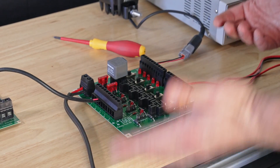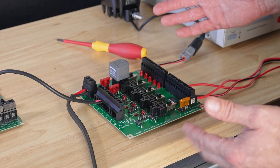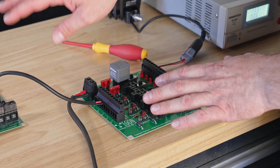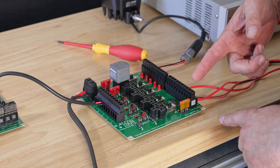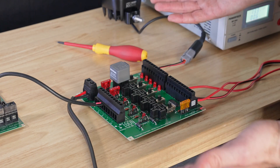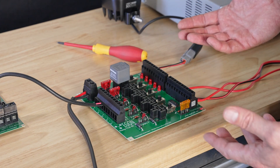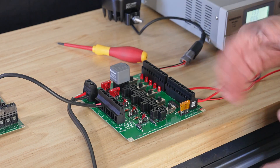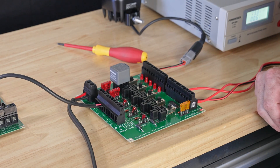You can mix and match different power supplies and different input triggers. You can even use switching from 5 to 30 volts, so in a 24 volt system with a 12 volt house battery you can have all your loads running off the 12 volt house battery but use 24 volt input triggers from the dash to turn these circuits on. This is quite a big advantage if you're working on trucks where you usually have to use voltage reducers — not necessary with the relay hub. This concludes our instructional video on how to connect the Egon relay hub to the Egon DC hub or another power distribution system. In our next video we will show you how to use this together with a battery box.